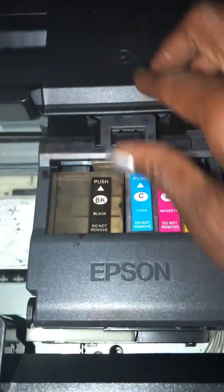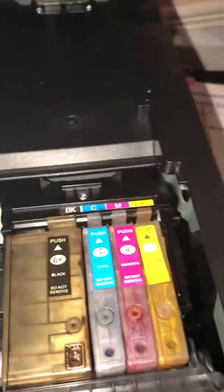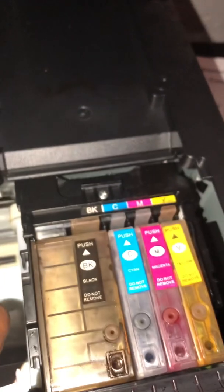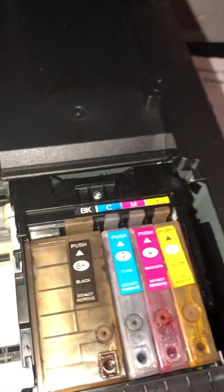Then I opened this up. What I first learned is that if you feel like there's air or anything in these vent holes, you stick the syringe in here and pull it up. If you can see that vent hole right there — I went ahead and stuck the syringe in there, and then pulling it up and pushing it down flushes the ink that's in the head. You're flushing it through.